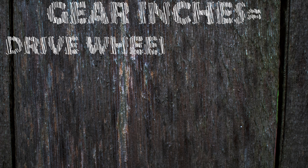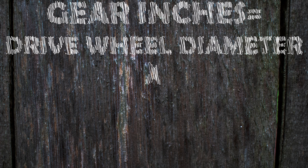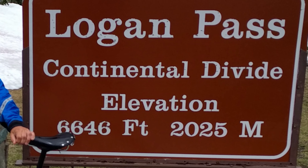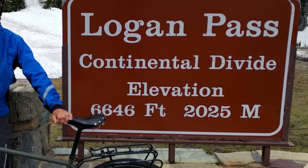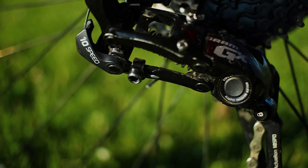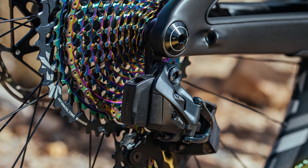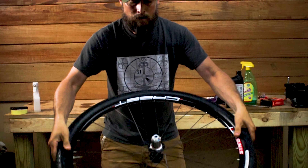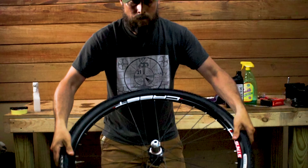What the heck is a gear inch? Simply, a gear inch is a measurement of mechanical advantage, typically ranging from around 20 to 120. Lower gear inches require less power to pedal and higher gear inches require more. That means you'd typically be using your lowest gear — your granny gear — to climb the steepest hill or riding with extra weight, and your highest gear to ride fast in the flats. An ideal drivetrain for bikepacking will have a low gear inch below 20 and a high gear inch of around 100. Gear inch range can be calculated using the size of your chainrings and cassette cogs; wheel size and tire width also factor in. For all the drivetrain options in this video, we'll use the most common wheel size, 700c and its equivalent, the 29er. I've built a useful gear inch calculator on my website — check out the link in the description.